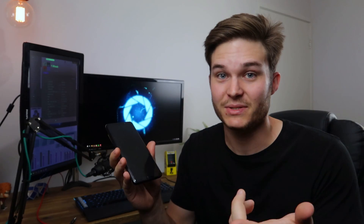So there you have it — that is how to clean a USB-C port on a phone. This is applicable to any USB-C port. If you've got a MacBook Pro and you're living that dongle life and want to keep those dongles sticking, just whittle out your toothpick, carve out all of that mess, the gunk, the lint, and you'll be good to go.